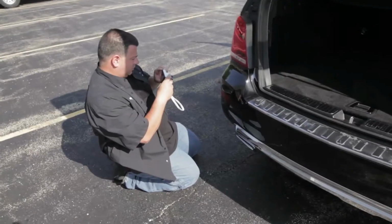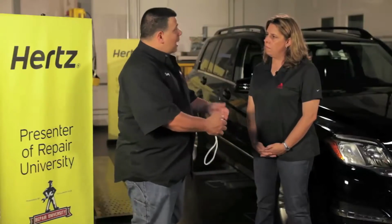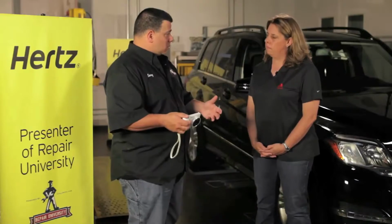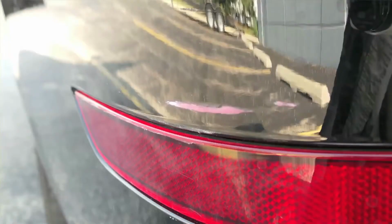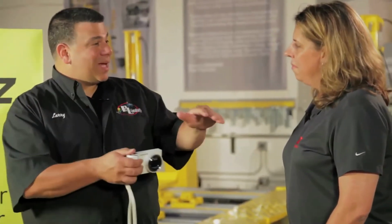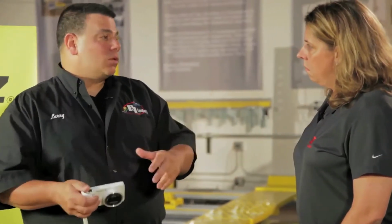And I wouldn't take the close-up of the damage. I'd take it a little further back, maybe come in a little bit, and then if I have some scratches or some sort of deformity that I need to really take a close-up picture of, I can go to macro or drill into about 9, 12 inches and keep in that area, take my photo. After I'm done with that, just like you write your estimate, I go to the headlight, get photos of that. I'd open the hood and take photos of the back side of the headlight while it's still attached, and then once it's off, you repeat the process. And that's the idea behind following and telling the story.